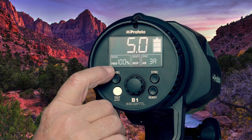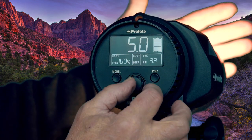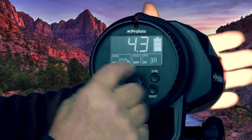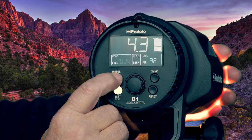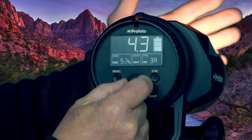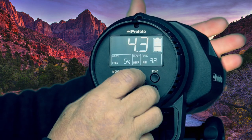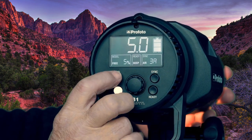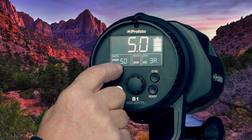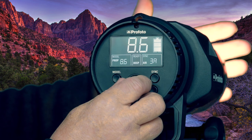Right now the unit is in free mode at one hundred percent. If you move your hand so you can see the modeling light more easily, you can see that as I change the power levels, the amount of the modeling light does not change — it remains at one hundred percent. If you want to change the modeling light in free mode, you can see it gets gradually more dim as you go down on the power, going anywhere from five to one hundred percent. If you press the button again, you can see it's now set to proportional and the value matches the power level. So as the power level goes up — six, seven, eight — you can see the light getting brighter and brighter.